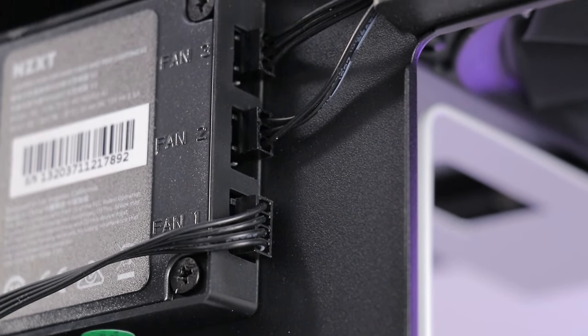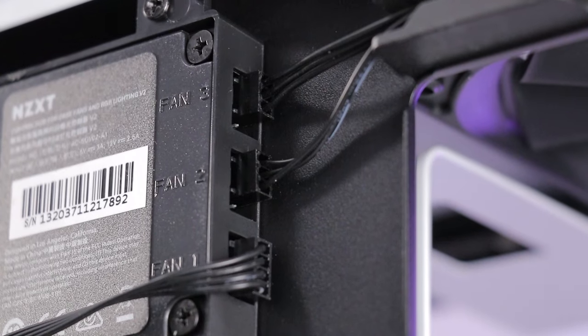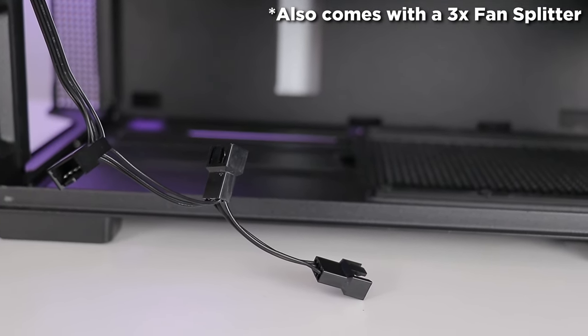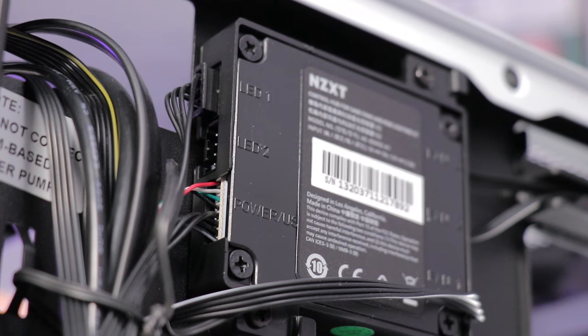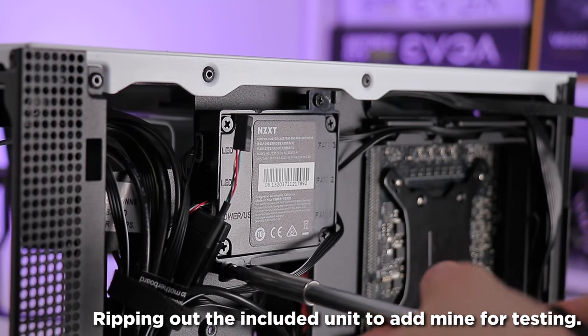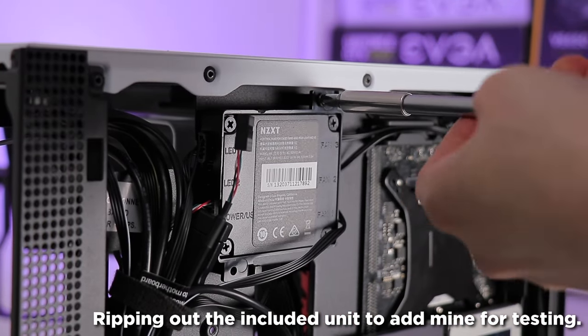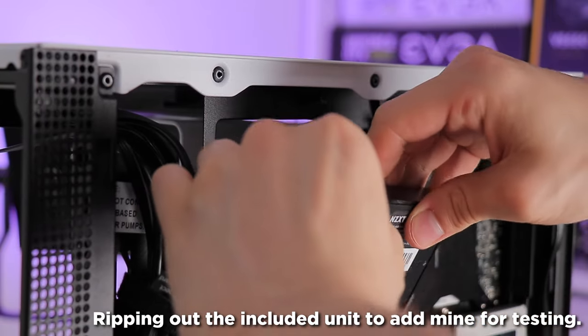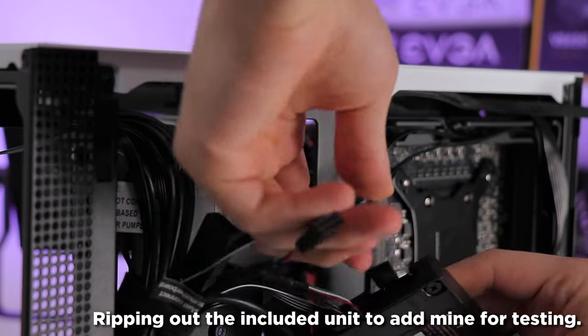A significant uplift in the cost of this unit comes in the form of the ARGB lighting and fan controller. On the fan side — a roughly £25/$25 unit — you can control up to 30 watts of fans across the three PWM headers, which is apparently equivalent to 50 Noctua NF-F12s. So you can fan-split the crap out of this thing for the four fan positions available. I'm not going to go into all the details about how the unit controls fans and lighting. NZXT can't seem to make their mind up about how CAM should work — CAM being their fan and lighting controller software. I prefer the old version of CAM 3 since later versions ripped out refined fan speed control. The general idea is you can control fan speed and lighting elements individually with different settings. When it works, it's really solid, but it can be finicky.